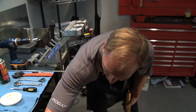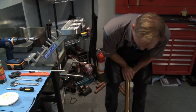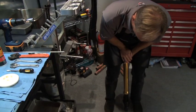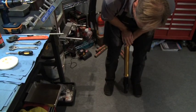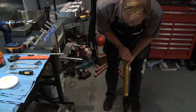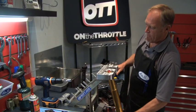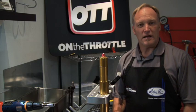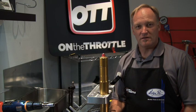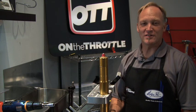Now we need to put the fork back on the floor because the cartridge is full of air and we just put fresh oil into it. So we need to exercise the fork twelve to fifteen times to get all the air out of the inner cartridge. That completes the basic fork oil service on the Suzuki GSX-R1000 fork. Now that you've done that, don't forget the other leg — go get that. As always, we thank you for watching and we'll see you next time.